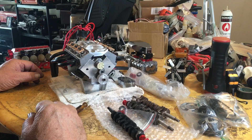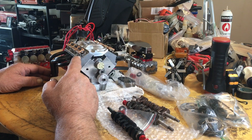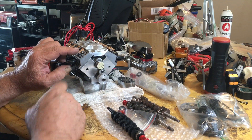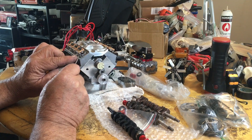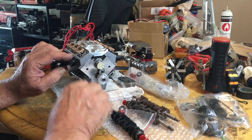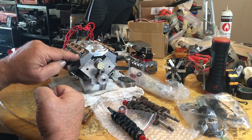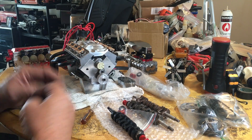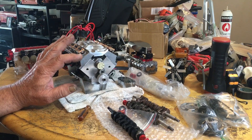I ordered a set of billet heads that are ready to go — they have seated valves, brass retainers, all that. I think my problem with the current heads is there's too much slop in the valve stem, so it's sucking air through the valve stem instead of pulling the charge into the intake. When the piston comes down and the valve opens, it should pull the charge in, but any external leak around the valve stem means it sucks air first.